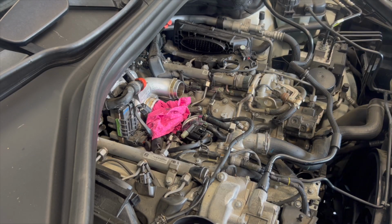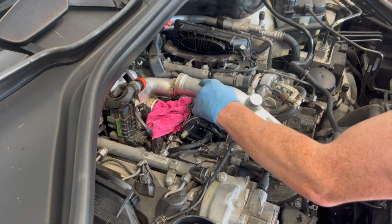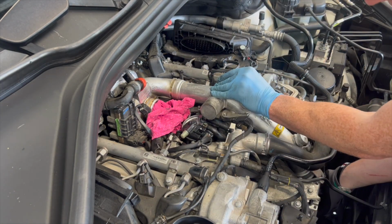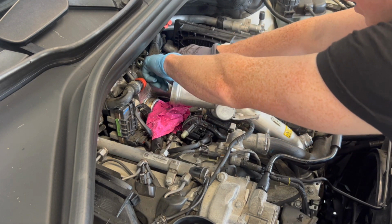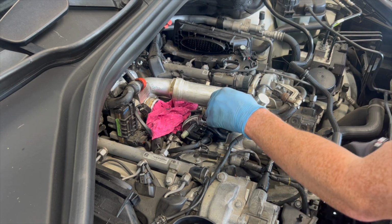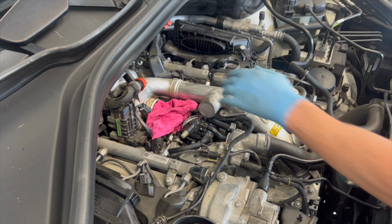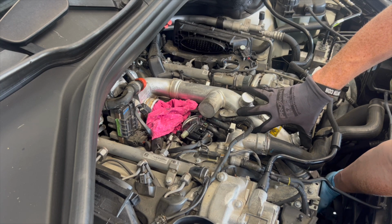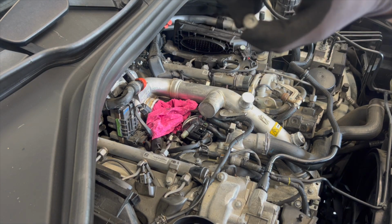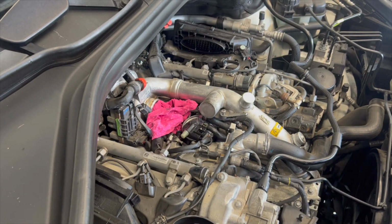So our O-ring's back installed, team, and we've cleaned down the bottom and also cleaned the intercooler inlet, which I believe it is. So then we've put this hose back in, just loosely for now. Got our O-ring back on. And all we want to do is just assist the snout to snug back over. And down here, we just want to make sure this is aligned properly. So this one here, the female Torx screw, goes on top, and then the little short Torx screw goes down the bottom here.